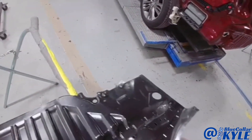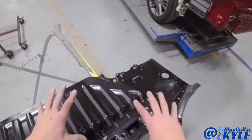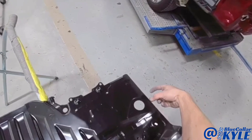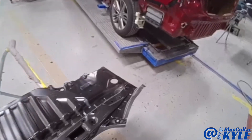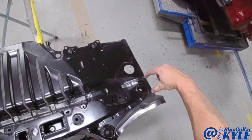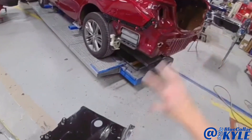Every time before I cut a rear body panel off, I go through and look at the new panel to see how many layers of metal it has — because depending on the panel, some are designed differently and some will have double layers, two pieces sandwiched together. That tells me I have to grind through two layers of metal. This one however is just single layered almost all the way around, except for right here and where this plate's at, so I know how many layers I need to cut through.